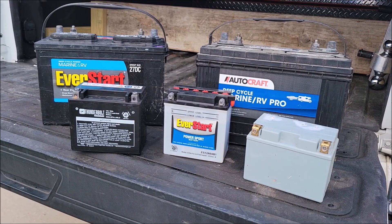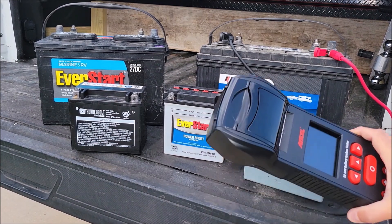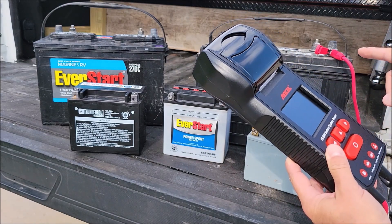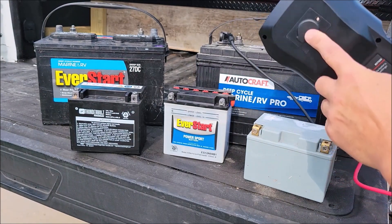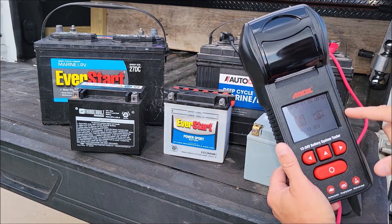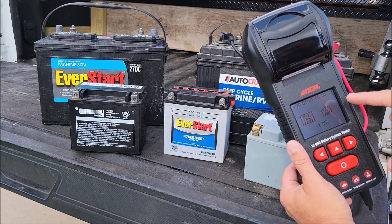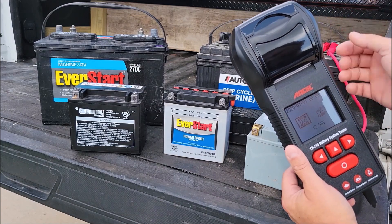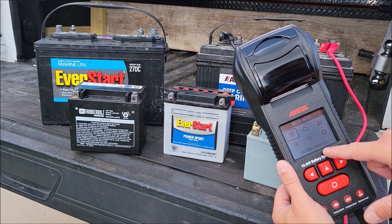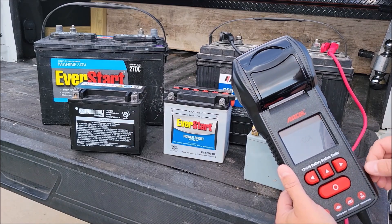To test the battery function I'm using lead acid batteries. When you hook the tester up before connecting to the battery it's not powered on — it uses the battery's power to run. It does have a small changeable battery in the back just for memory functions. It starts up, detects a 12 volt battery, and I select 12 volt battery for a capacity test on this regular wet battery. Cold cranking amps on this one is 675.